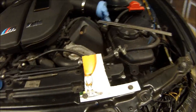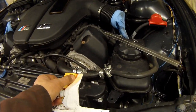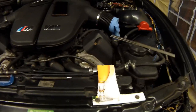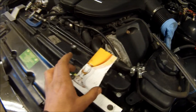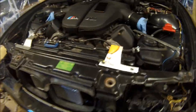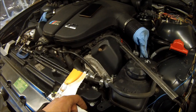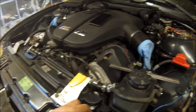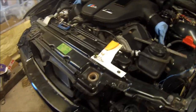That side is done. Like I said, this side you just literally flip the pattern over. Because the radiator is virtually central within a mil or so, this bracket will be exactly the same, maybe shifted over a millimetre or so. I'm going to start making that now but I need to extend the template to come round here to support the coolant reservoir as well. I'll take two pieces of card together to give me the pattern I need.